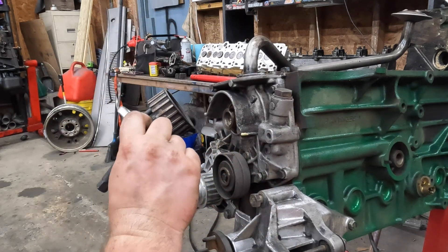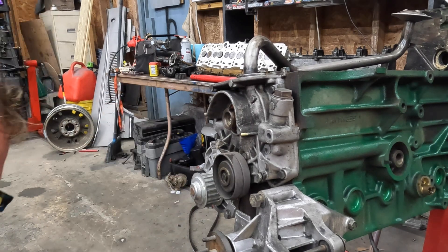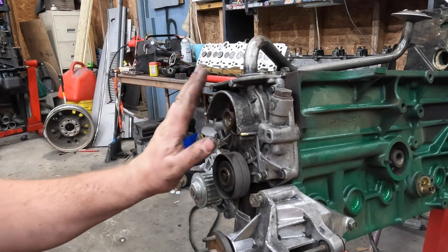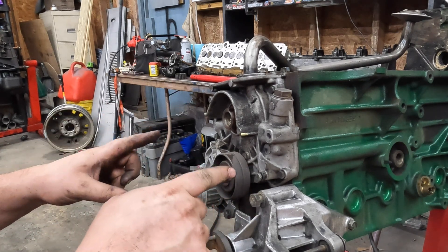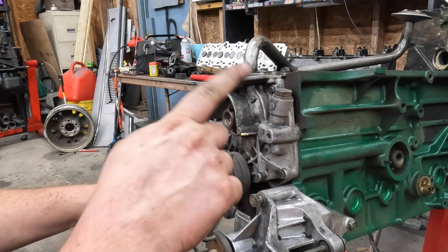Usually it's tight. The rarest of occasions has occurred — I have had a brainwave, foresight. I'm going to flip this back over and measure my piston protrusion now so I can try to get a head gasket ordered, if they even exist anymore. So let's do that.